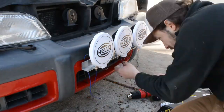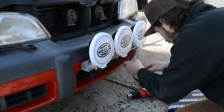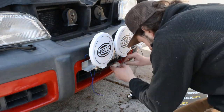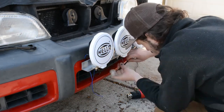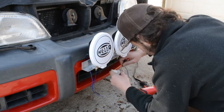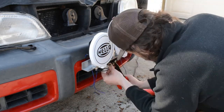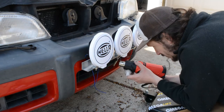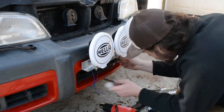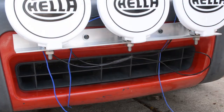At this point just connect all the wires together — blue goes to blue, black goes to black. With this wiring being exposed on the front of the vehicle I wanted it to be as sealed as possible, so I used heat shrink style butt connectors along with adhesive style heat shrink tubing over top of that. I haven't taken the car through a winter yet with this setup but I have gone through some rain storms and washed the car a few times since installing the fog lights, and I haven't had any problems with the wiring.